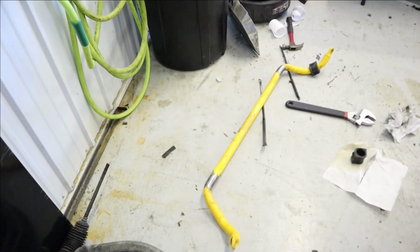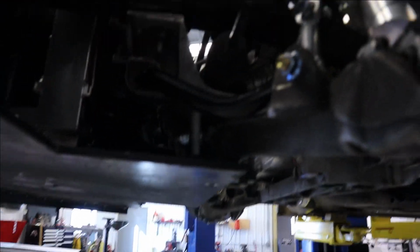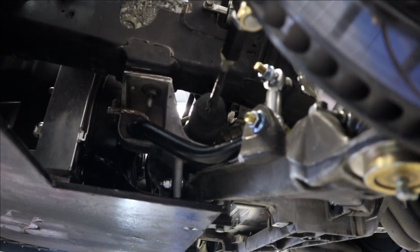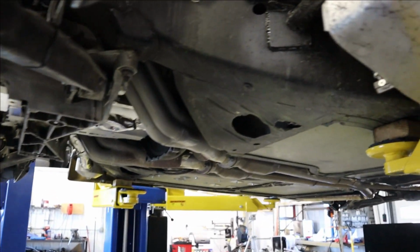So I've done before and after with that, and it's absolutely noticeable. I replaced the front sway bar, which is a pretty beefy unit. This is a 36 millimeter Johnny O'Connell that was in the car, and I replaced it with just a standard Z06 30 millimeter because I need the front end to bite. I know there's a number of handling issues from Coda, and not surprising. I mean, we have zero testing on the car.